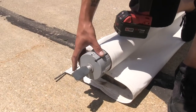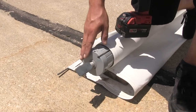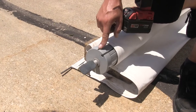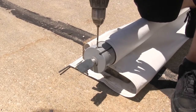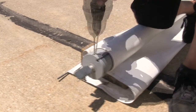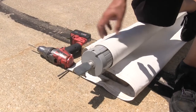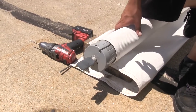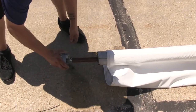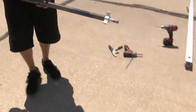The caps on the end are going to have to come off, so we're going to need to drill through the rivets that are holding our end cap on. Yours may look a little different — you may have screws or bolts, in which case you'll just need to remove those. I'm going to take about a quarter-inch drill bit and drill through my rivet. With both rivets removed, we can start sliding the cap away, which is going to expose the spring assembly, and we can set it aside.